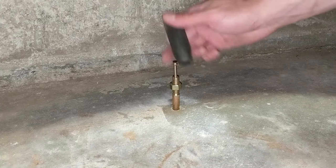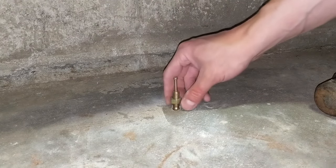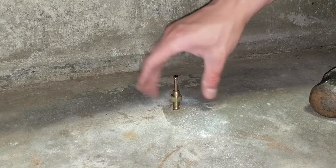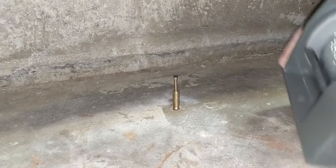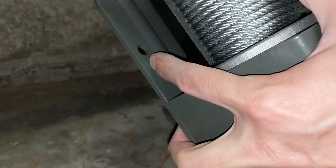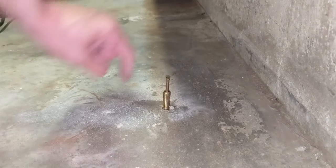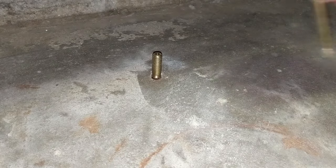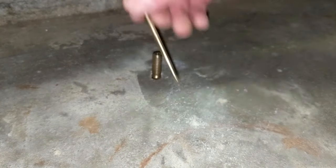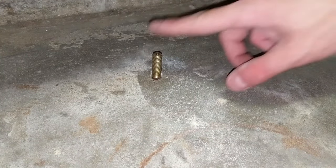You'll see this goes around the pin and around the bolt but not around the nut. That's bottomed out right there. Before I set this thing, I want to make sure that the winch will even go over it. Except I forgot that I need to bore out these holes a little bit because they're meant for an 8mm or 5/16ths, and these are 3/8 inch bolts. You can also probably tell that my bolt is just a little bit off kilter, angled back a tiny bit, but I think it's going to be just fine. Interesting discovery too — the pin comes out, it's basically just a nail, so you can take that out if you need to hammer right on the stud, although you want to be careful not to damage the threads.